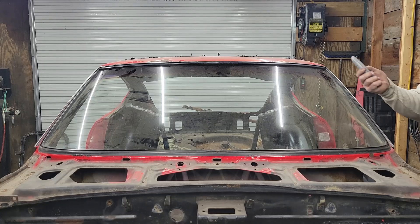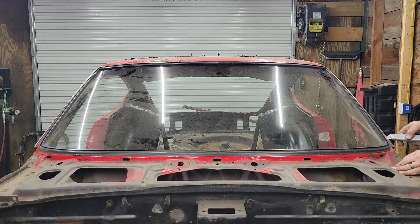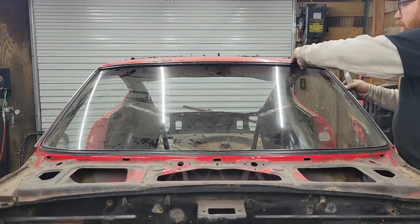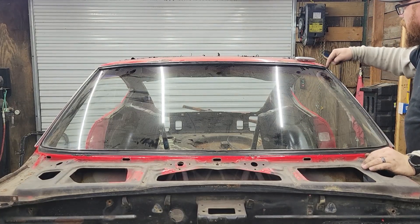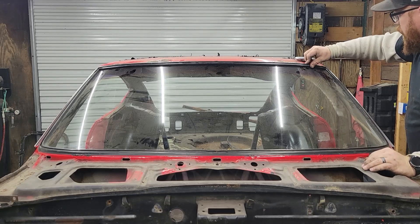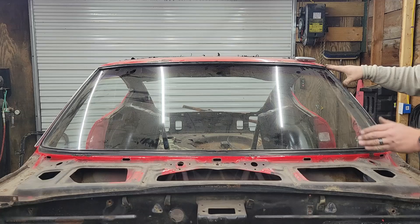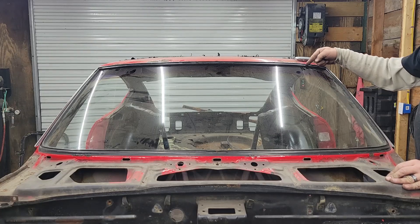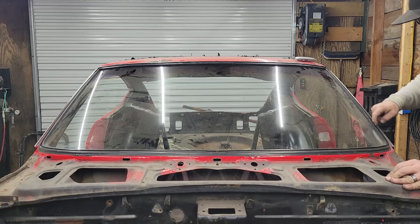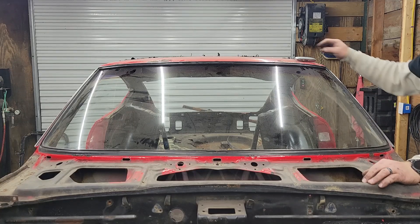Now we've got a nice brand new blade on my utility knife, and we're just going to trim this rubber right down here where it covers the windshield, and hopefully the windshield will pop free. I really would rather not have to buy a new windshield if I can help it. Looking at it, if we just cut on this line back here basically — because it's not really sealed — the rubber kind of encapsulates the edge of the windshield, and then it's all probably glued down; the rubber itself is probably glued down to the body of the car. So I think as long as we trim right here, right along that line where that chrome piece was, and then peel that off, I believe the windshield will pop right out.